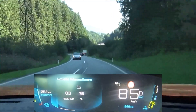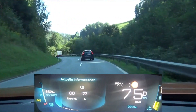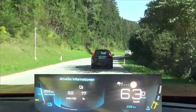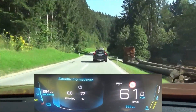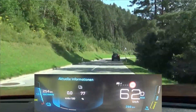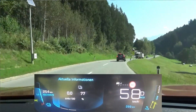The Zoe has a 100 kilowatt motor. Here's a short clip with the Peugeot E2008 on the same section. Going down, I'm almost reaching the maximum capacity of the charge section of the power gauge, which means I'm already reaching full regenerative capacity of the electric motor. It may well be that most drivers exceed the regenerative capacity and therefore use the friction brakes, meaning they cannot use the full capacity of regeneration — reducing range and increasing consumption.